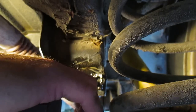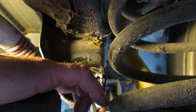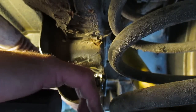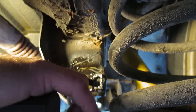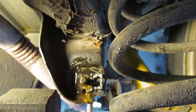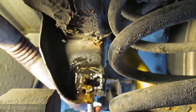This is the other side, the side that the nut was on. That nut came off no problem, and you can see as I spin it, I've got my ratchet on the bolt from the other end and it's just turning and turning. I've been beating on this side of the bolt, protecting the threads. If you want to reuse that bolt, protect those threads. But that bolt will not go back through the bushing.